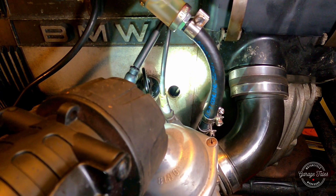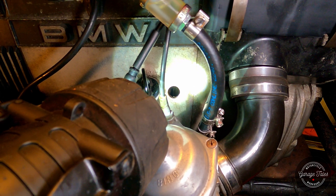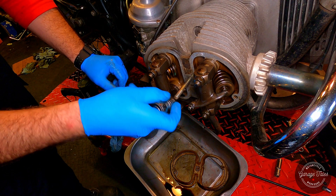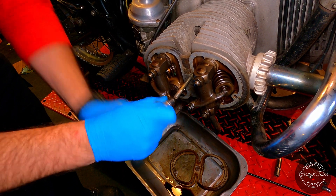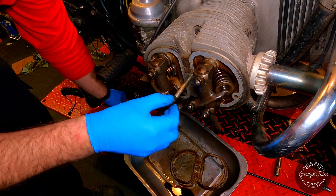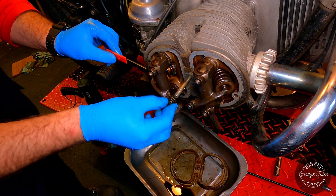Next I'm going to put the bike in last gear and turn the engine over by turning the rear wheel until I see the top dead center mark in the inspection window. Then I can check if the rockers are loose on the side I'm working on; if not, I'll turn the engine over another complete revolution. Checking the rockers are free just to make sure I'm on the top dead center of the compression stroke on this cylinder — which I am — and these valves are too tight for me to even put the feelers in, so I have to loosen them up first.